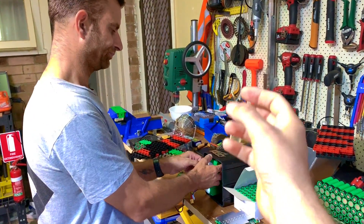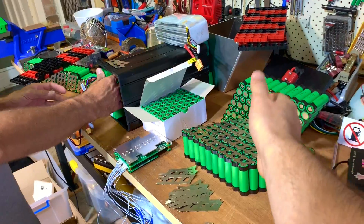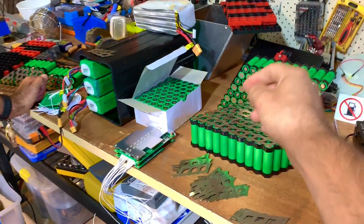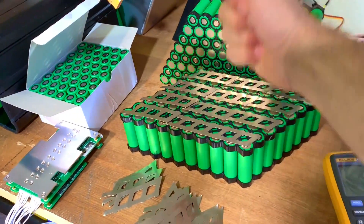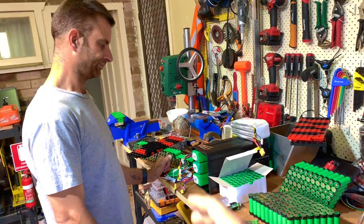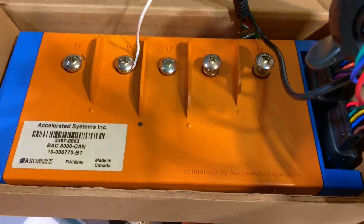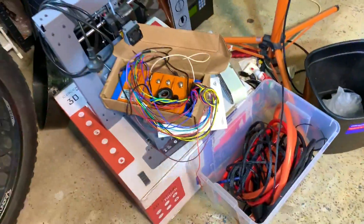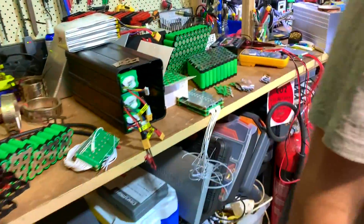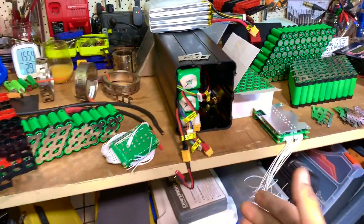What's the difference or advantage of using lipos instead of 18650s? 18650s are more reliable, but there's a lot of labor - like spot welding. With lipo cells you can go crazy high discharge. You can use super powerful controllers, like this ASI 8000 at the back here - that's got some serious power. So we might need lipos for some serious builds. It's good to have two options - we can do 18650s, we can do lipos.